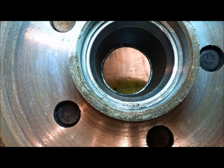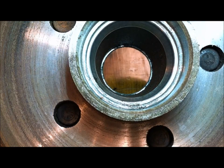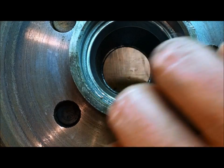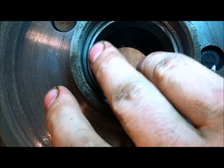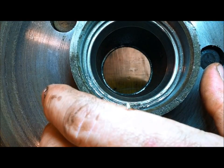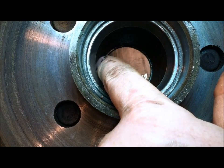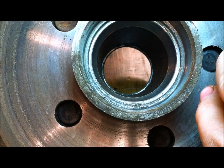Now that we've established our bearings are junk, we're going to have to get these inside races out. There is a trick to doing them — you can take and run a bead of weld around the inside of that inner race, and when the weld cools it shrinks a little bit and it'll squeeze that race together. Almost every time I do that, the race will fall right out. Since most people don't have a welder, we're going to pound these ones out. That shiny spot down there is the front inner race, so we'll just get it hammered out, flip it over, and do the same thing on the back one.